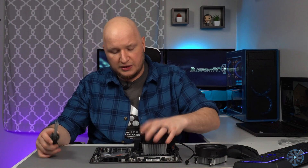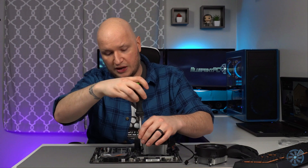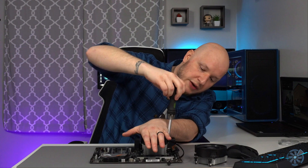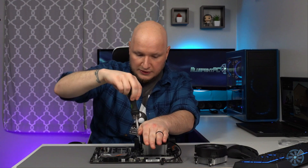I hope this helped. Outside of that, I know these coolers can be finicky — my first time installing them the screws felt quirky. A little bit of pressure on the screws, or just pushing down on the cooler itself, helps because the spring is going to have pressure once you tighten it anyway. Pushing down helps seat it better, and then you can start one screw and if your screwdriver is long enough start the opposite side, then switch.